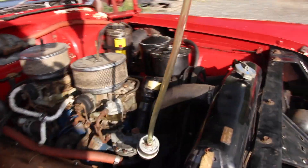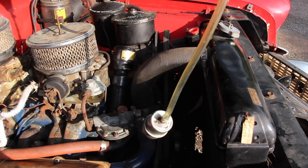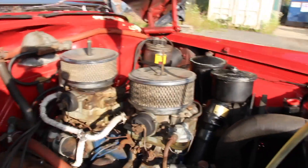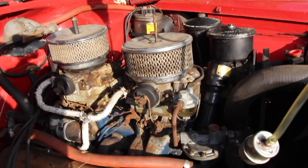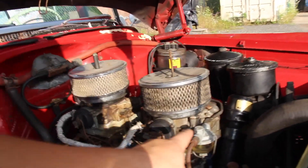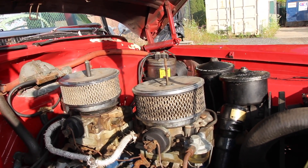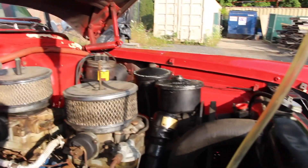On this car it's really easy because the fuel pump is right here. Just hook to either your fuel filter or your fuel pump and then pour some gas in, let it drain down, and you should be getting proper fuel to the carburetors and should be able to gravity feed it. Also, if your carburetors have a line hooked straight to them, you can feed them directly to the carburetor. That way if your fuel pump doesn't work, the fuel will trickle straight to the carburetor and it should still work.